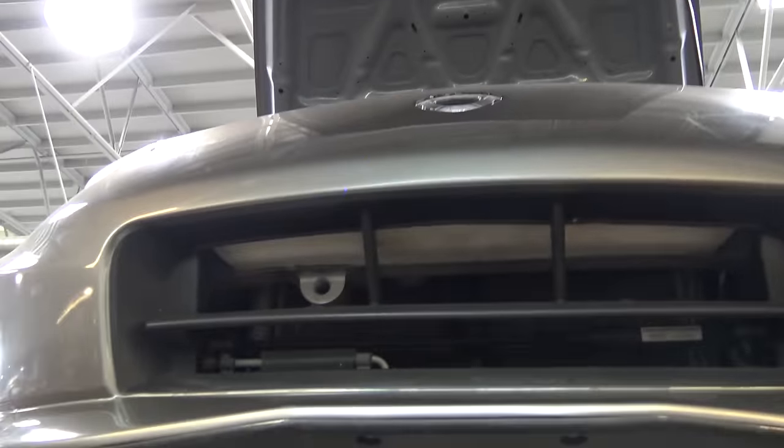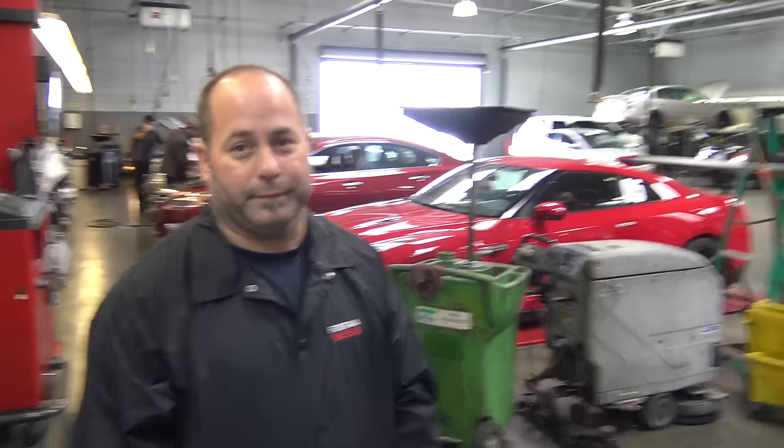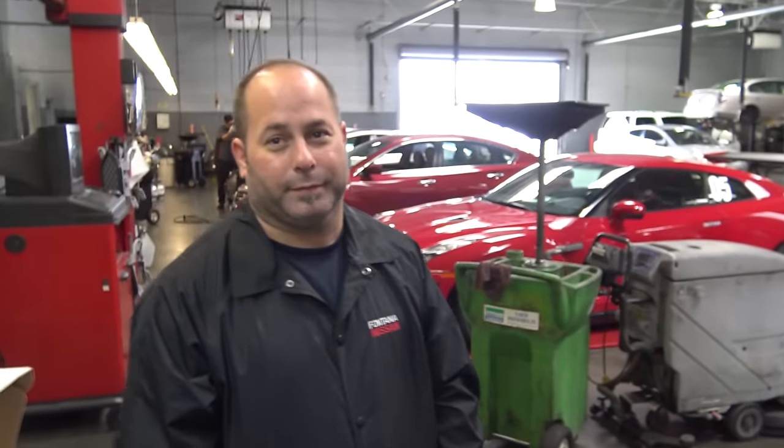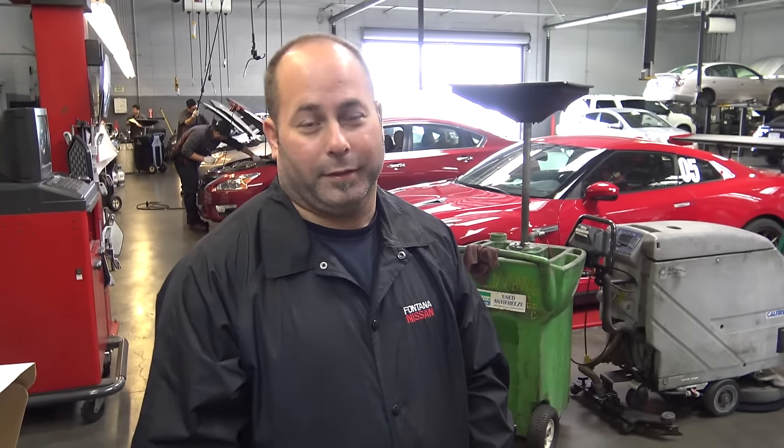You've got a lot of cold weather guys who don't worry about engine coolers or oil coolers as much, but here in the desert, that's like the biggest thing. Sitting in traffic on Thanksgiving Day when I bought this, it was 65 degrees and the oil temp still got to 240 in traffic. We're talking the car maybe saw 2,000 RPM for 20 miles and it still crept up to 240 degrees on a 63 degree day. I mean, that was crazy. That bugged me when I saw that. We've got some things to do to this car.